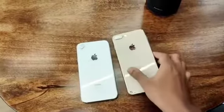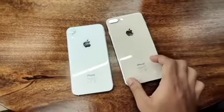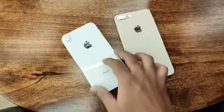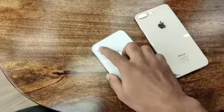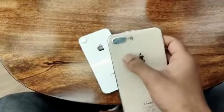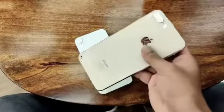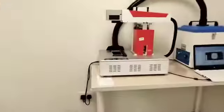What we will do now is replace only the glass panel using a laser cutting machine. I'll show you how to do that. There is some covering on the camera — you can see here there is foil paper to protect it from the laser cutting machine.